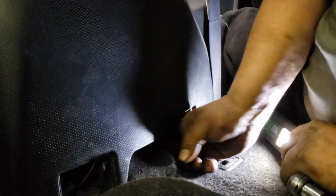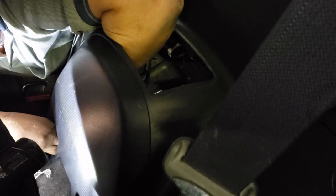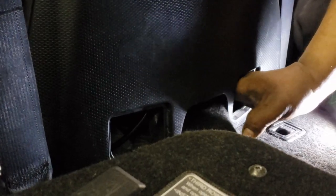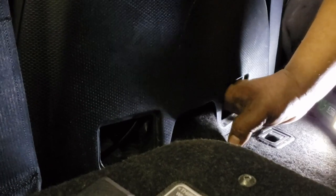Be sure to line tools very well through the slot provided at the bottom of the wheel well so that you can get to the two top nuts. Very important when reinstalling: use your finger to start the nut before screwing on.